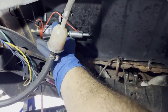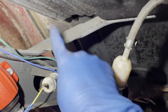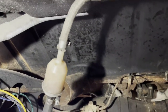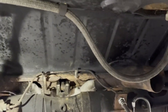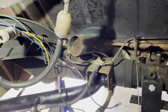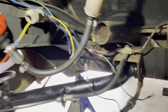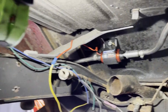And then because that'll give me enough room to run the line over to the inlet. And then I can run the fuel line off of this side around this bracket and kind of zip tie to this, and then it'll already be where it needs to be to meet the engine, and that keeps everything up nice and high and hopefully stops things on the road grabbing it, or if the axles fail or whatever. So I'm gonna move that over there, and then I guess I can start trying to fit the transmission back in after that and torque up the axles. And then maybe we'll bleed the brakes and focus on the engine for the rest of the day. You know, something like that.